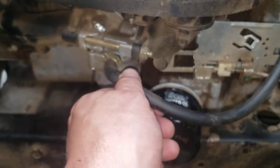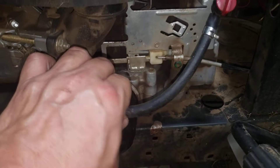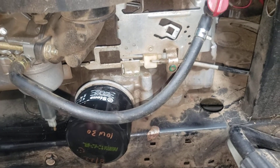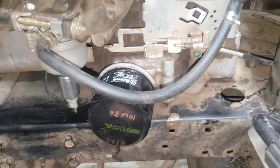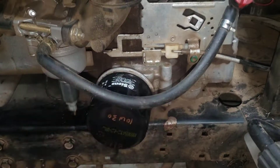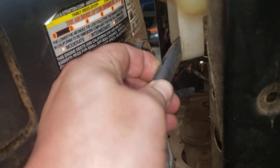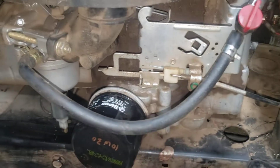This is an aftermarket carburetor, and the way I can tell is this fuel line is very hard. The number one primary reason for that is the Chinese fuel line they are selling us Americans is very crappy. If you look at how this one is pliable — it actually has some nylon cord in it — this is just straight rubber hose.